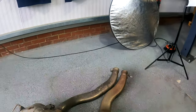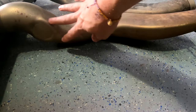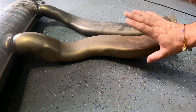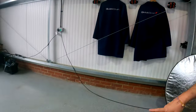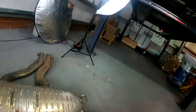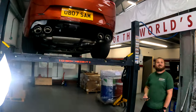The other thing worth mentioning is these hydroformed tubes that Range Rover Land Rover use to navigate around the rear axle — that is very squished and that inhibits flow of exhaust gases and performance. The other thing is this is old-school exhaust engineering: there are no valves. I'm a big fan of that, but on a car like this you might want something different, as we've demonstrated on the road.